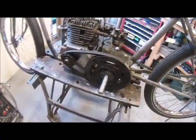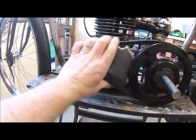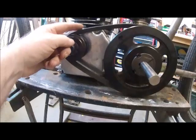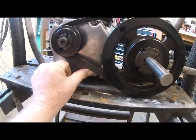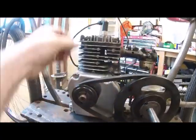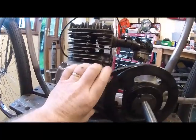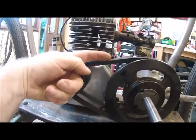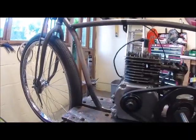Which should be terrifying enough! You can see I've got a bit of slack on the belt. The idea with this is it's going to be the slip. I'm going to make a pulley that either pushes down or pulls up on here to create some tension with a lever, which I'll lock in — and then that will be the clutch. Or I might just run an idle wheel pushing down with a cable up to a lever, like a normal clutch, which might be easier to operate.